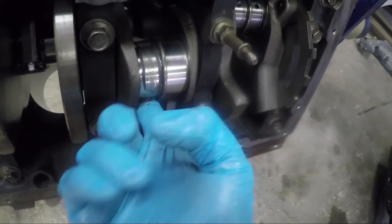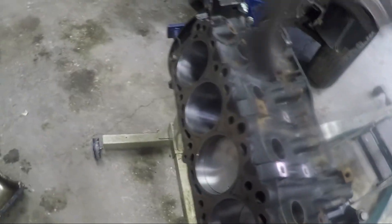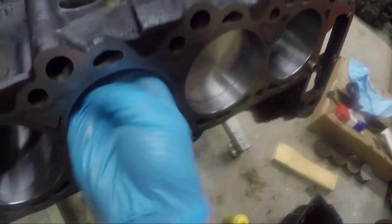Smear that on there. I need to be able to grab the connecting rod so it doesn't scrape into the cylinder. I also need to wipe down the inside of that cylinder as well, so I'm going to grab a new rag — clean out any debris that could be in there, nice wrap all the way around, fold it, do one more pass. And then I'm actually going to take this oil and lubricate that cylinder — just do a ring around and work that oil in there so that your piston slides in nice.